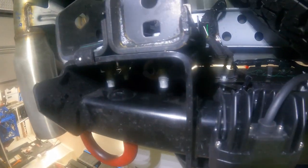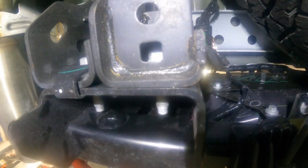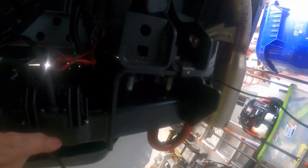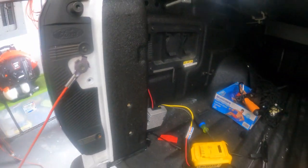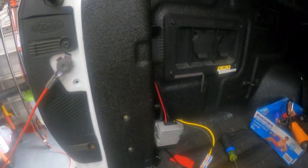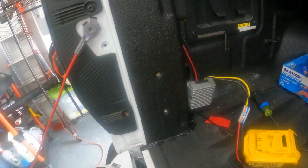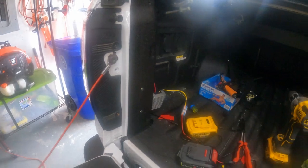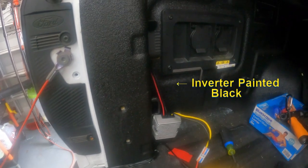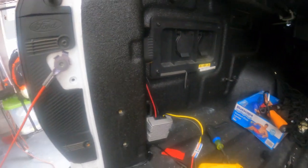Here's a quick view of where I mounted the wire that goes from the passenger side power supply down through the bottom. You'll see there's a gap between your truck bed door and the actual vehicle itself — there's a nice little space in there. You drop the wire down through there and come up through the bottom. The little areas where you see the green ties are where I zip tied them underneath the carriage around the back, around the spare tire, and back up through the passenger side hole in that same little gap. Then around the corner where I installed the power inverter along with the DeWalt battery.